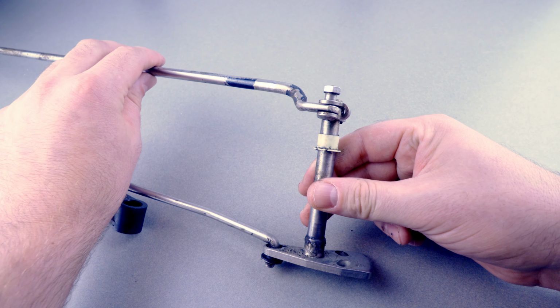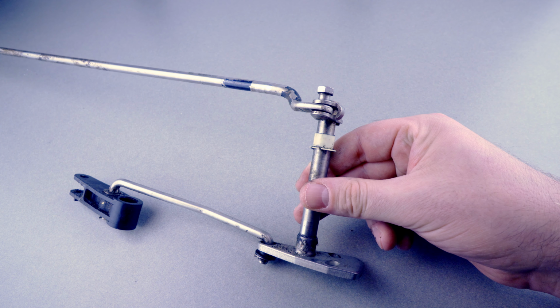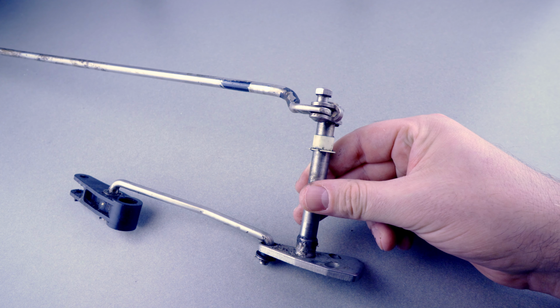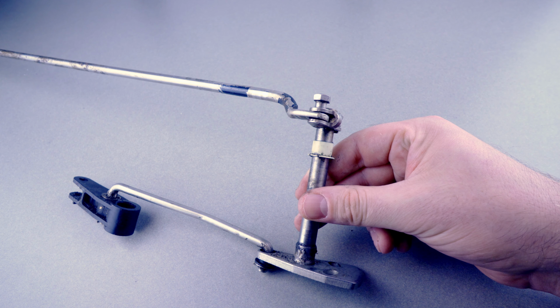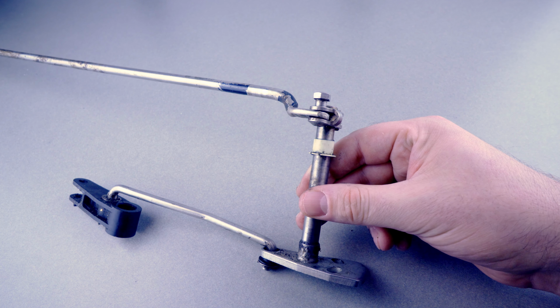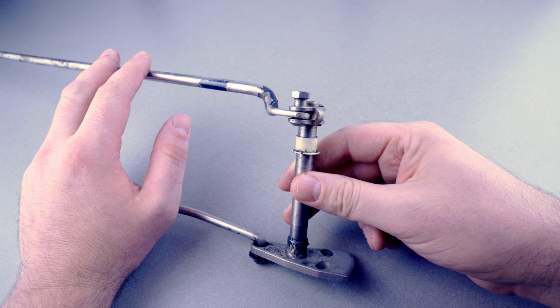Now, the reason that I don't like this design is because of the thread. I've had this happen to me 2 times, and the shift pin fell out, and the motor got stuck in forward both times. And luckily, it got stuck in forward because it was still working. However, I can't imagine I'm the only person that's had this happen, as this has happened to me twice.